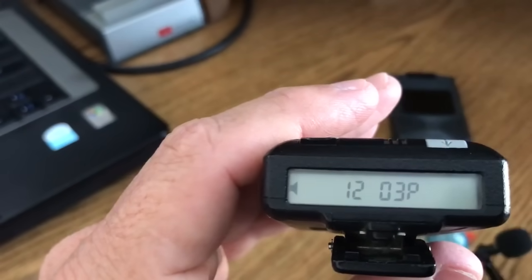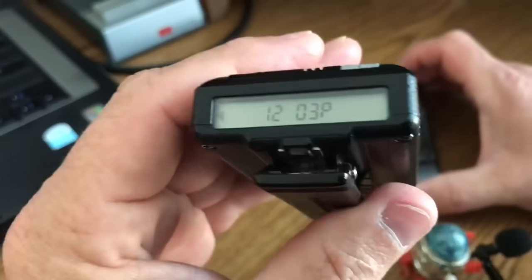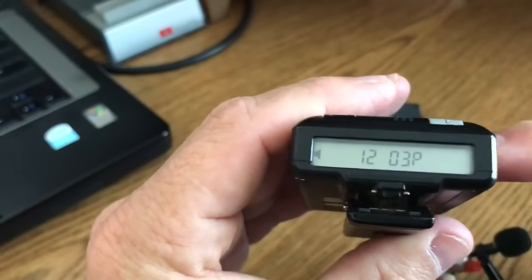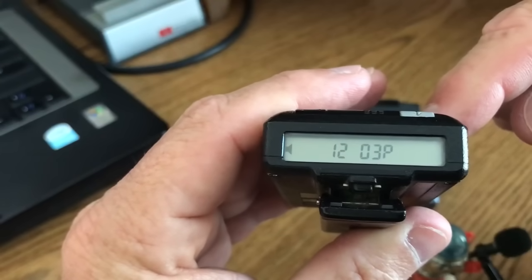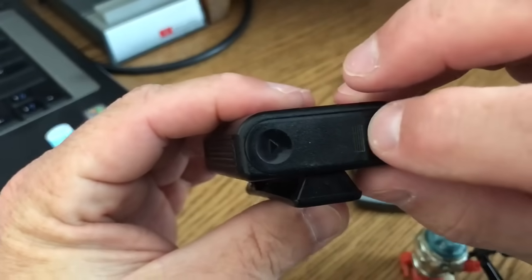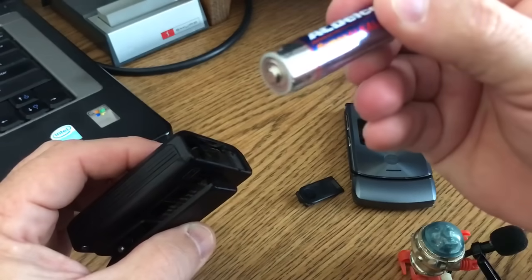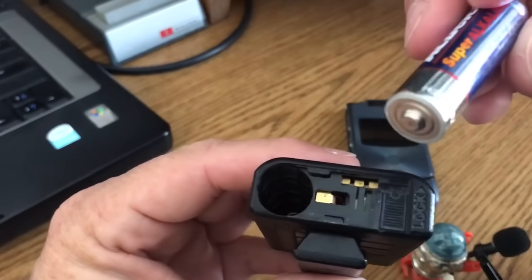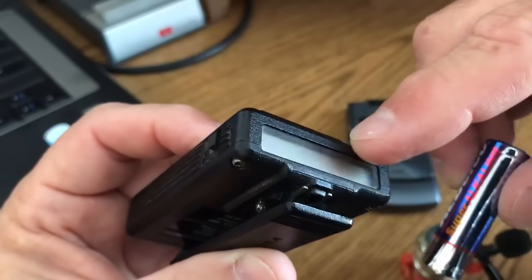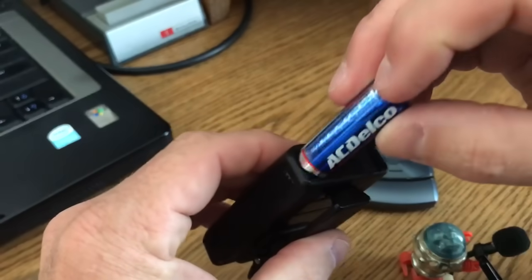Either put in your phone number and it comes up on the display, or you leave a voicemail. Now the other neat thing about pagers is the battery life. A cell phone — even a good one — the battery is good for maybe four days. Your typical iPhone or Galaxy, what do you get, a day? Pagers go for about three or four months on a battery and you don't even have to recharge them. The pager uses AA alkaline batteries, or some use AAA. You just unlock the battery case, slide this little door, and out comes the battery. When the battery gets low, the screen will say 'low cell' and tell you it's time to replace it — but the pager keeps working for another week or two. Utterly amazing.